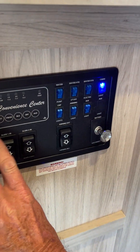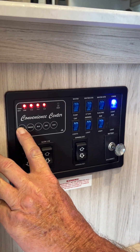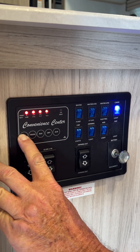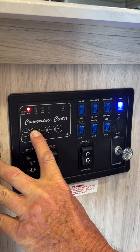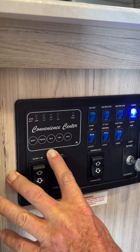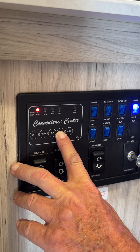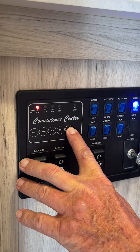We're going to step down and check on the monitor panel. It shows you that your battery is fully charged, but that's not really accurate — to get an accurate reading of the battery you need to have the 110 line unplugged, then push your battery button. Fresh water tank underneath the unit is drained. Black tank, which is your toilet water, is drained. Gray tank, which is your kitchen sink, bathroom sink, and shower water, is drained. It is also prepped for an auxiliary tank but doesn't have the tank on it.